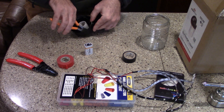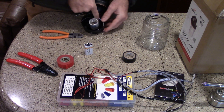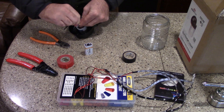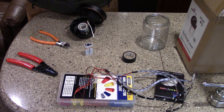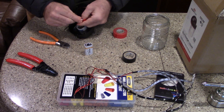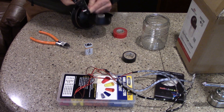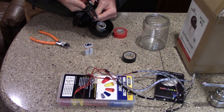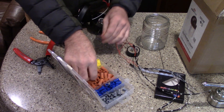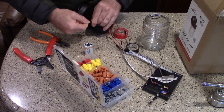Here's where the diagonal pliers come in — I'm going to cut the white wire here, and cut the black wire. This is a pet peeve of mine: with DC you've got red and black, just like your car battery, just like your booster cables. So I get this red tape and put it on this white wire — now it's red. I'll get the strippers and strip it out. Splices are actually bad — the less splices you have the better — but I've got a reason I'm doing it at two places and I'll show you in a minute.